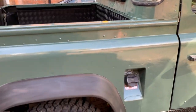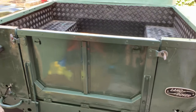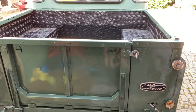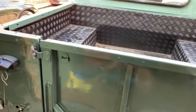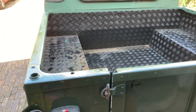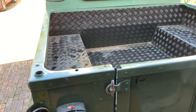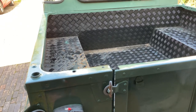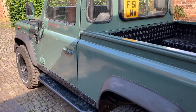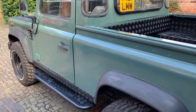If you've experienced Land Rovers before, a jolt when you take off or accelerate hard usually means one of three things: the prop shaft splines, the stub axle drive axle splines, or the diff. Looking underneath this morning on an axle stand, I noticed the prop has been off before and has new bolts, so presumably the prop was already checked. It must be the splines on the stub axle or the diff. There's a lot of play on that front shaft, so I'll do a video on that — maybe tomorrow.